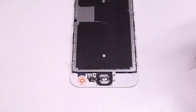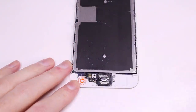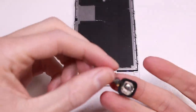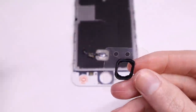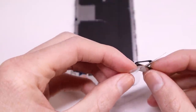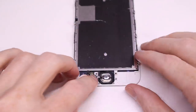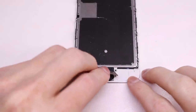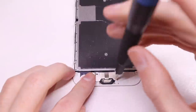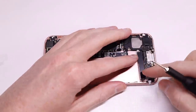Next I can move along to the home button on the display. The gasket which is supposed to adhere it down to the display is doing nothing — it's not even attached anymore — and this means the home button feels really loose and is actually spinning around. If this is left too long, the home button cable could become ripped and I would lose Touch ID on this device forever. I bought a heap of these gaskets online from eBay for about five bucks for 15 of them, and they're great — I've been using them on every screen replacement since, because it stops the home button from wobbling and makes the phone feel brand new.